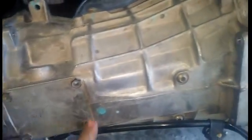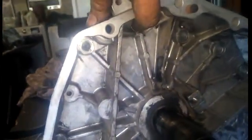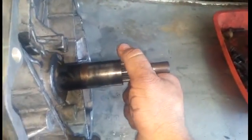You're going to have to remove these two — it's four total. I believe that's a half-inch bolt on that, half-inch socket. And then there's a bunch of bolts on the inside. These are all 15s all the way around, and you're going to want to remove those. This particular unit — I've got to figure out why — it has a lot of slop on the input in and out, so I've got to figure out what's going on. But this is also the same procedure.